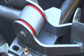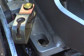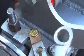When mounting the trailing arm, square it up as much as possible before installing the U-bolts. Because this car's been tubbed and the diff shortened, we've had to make a few minor modifications, namely for the location of the handbrake cable where it fouled the U-bolt. It's a simple job though, just shorten the U-bolt.